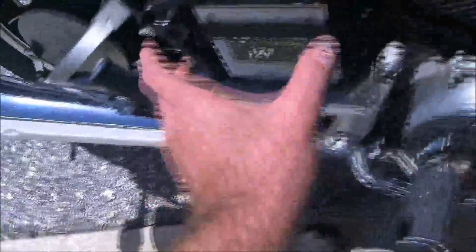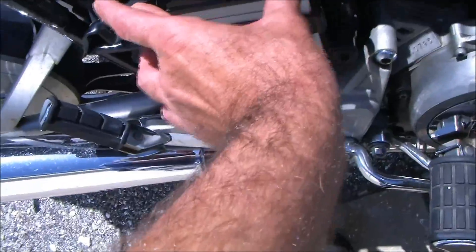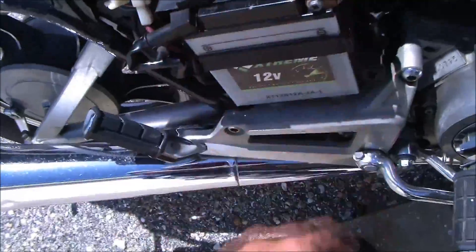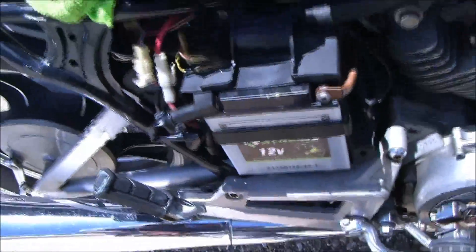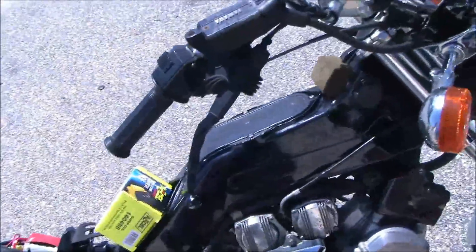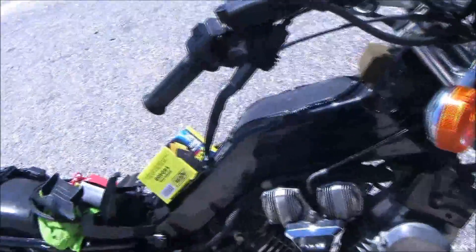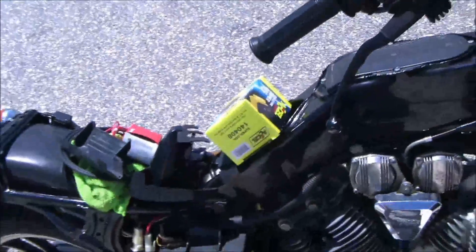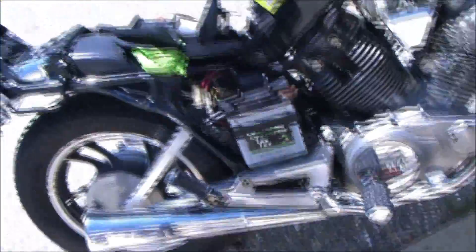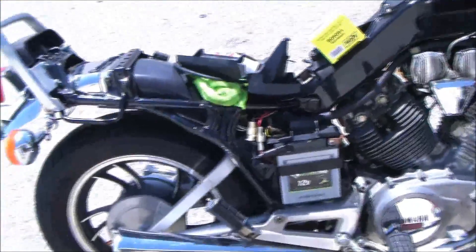If you want to see if it's charging, put the battery in the bike, run it a little bit above idle, put your meter on there. If it's throwing over 12.5 and you rev it and it goes up, you're doing good. Suzukis, around 3500 RPM they'll drop back a little, but as long as they're in the low 13s — 12.9 or higher — count it good. Kawasaki: if it's above what the battery was when you first let off the starter button, it's probably charging.